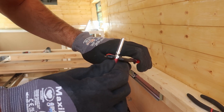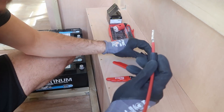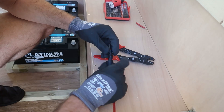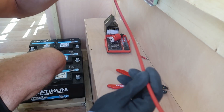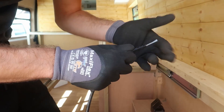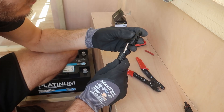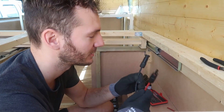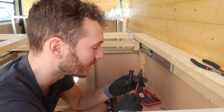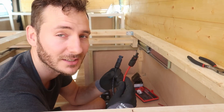There's the crimp, and with the crimping tool I'm just going to close the prongs — that's now on there nice and securely. Let's put that part on and put the rubber grommet back in. One connector done. Now same again with the negative — just twisting the ends to make it easier to fit the crimp, then squeezing the end. That's two connections done. I did notice some of the bits of wire were a little crumpled, but I don't think that'll be too much of an issue — I've left enough room to redo the connections. Let us know in the comments if you feel this is rubbish.